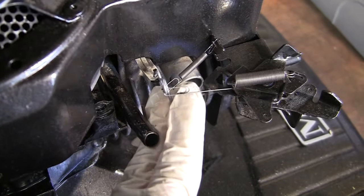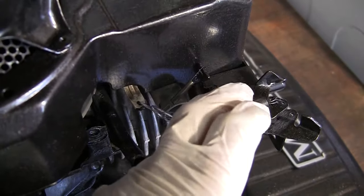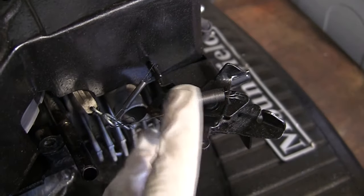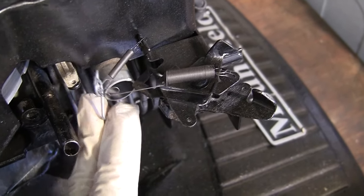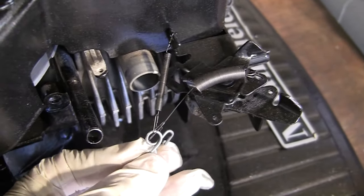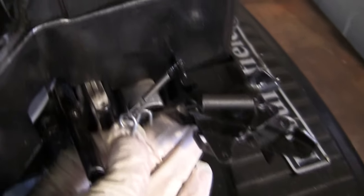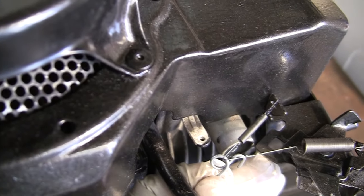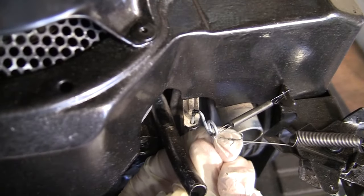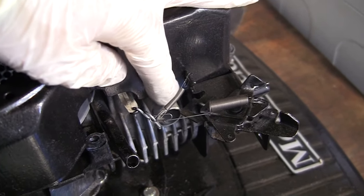They actually hook into here. There's this little loop that normally connects to the carburetor, which is something I'm going to show you in just a minute. This longer spring here goes into this hole here. You just need to loop these round and put these on there, then the other end hooks in here. As long as you get it round this loop, that's exactly where it needs to go. This shorter spring goes to this connecting rod here at the top and just hooks over there. And this linkage here just needs to hook back in over the top of there as well. Now that's where they go if you've lost them or you're looking to replace them.